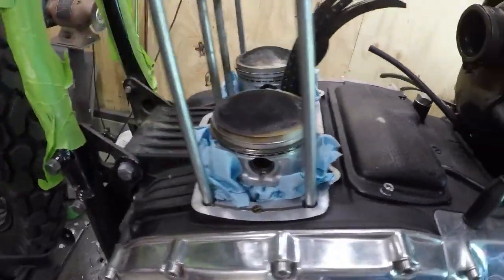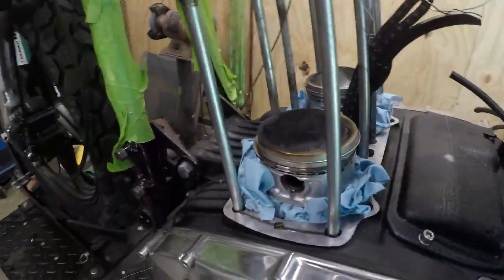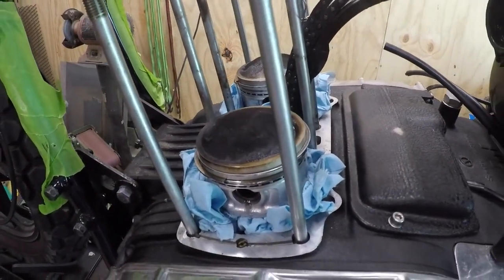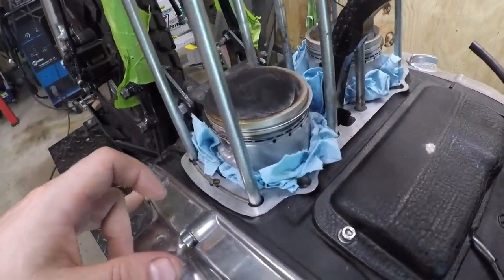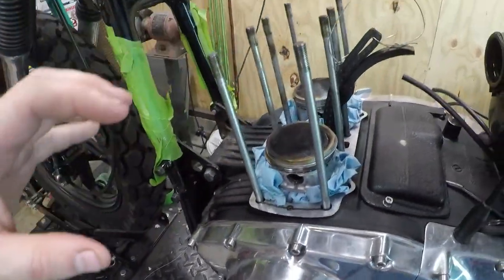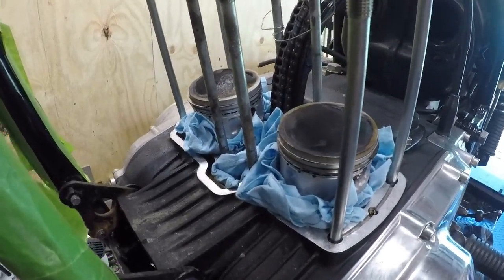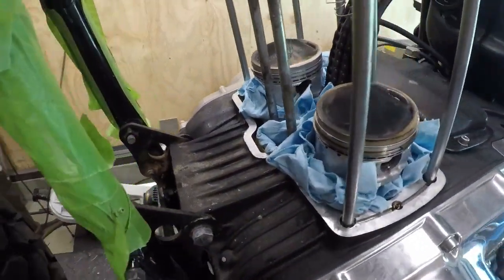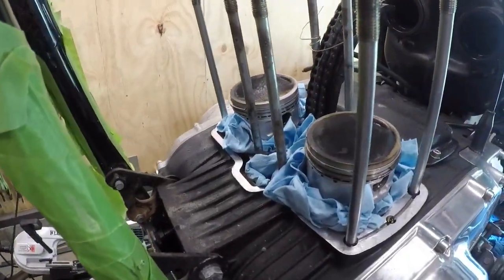And then I might go ahead and just pull the pistons off just to clean them. But as far as any broken rings or anything, I'm not seeing any obvious signs, so I'm still leaning towards head gasket. None of the rings are clocked in with the groove right above one another. I make sure to assemble it with the gap offset where it needs to be. So anyway, at least we're not seeing an issue there.